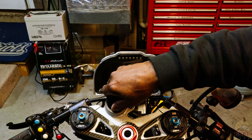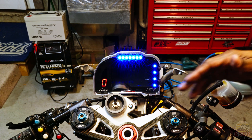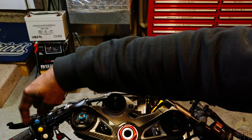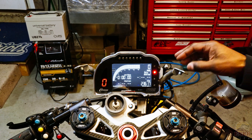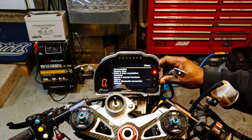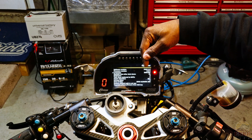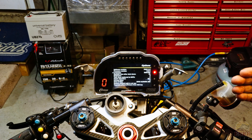The first thing we want to do is turn the bike on. If you are fortunate enough to have a bike where i2m makes control switches — left and right clip-on control switches — where you can navigate the menus on the screen, you can use those. Unfortunately, my switch does not, so I'm going to use the up and down navigation buttons on the side. We need to go into the menu using the lower button with a quick press — just press and let it go versus pressing and holding. Navigate down to Options, then press and hold. You can see our firmware versions here: Pro 2 version 6.5 and firmware version 118-6. Now you can take this information back to your desktop and compare it to what's on the i2m website.